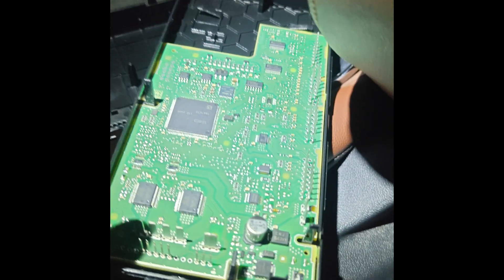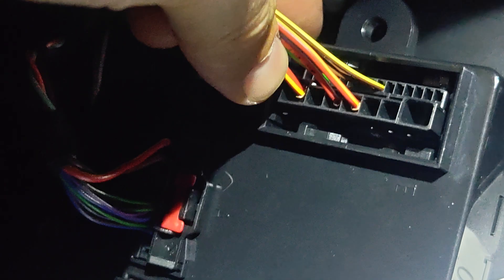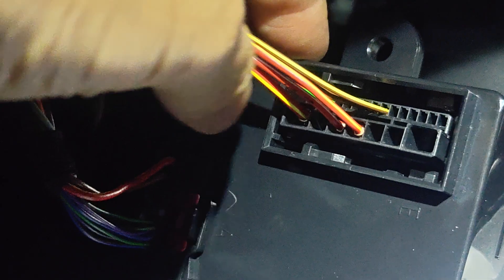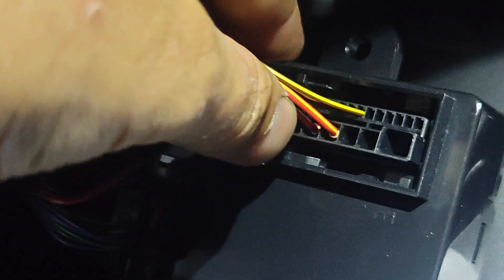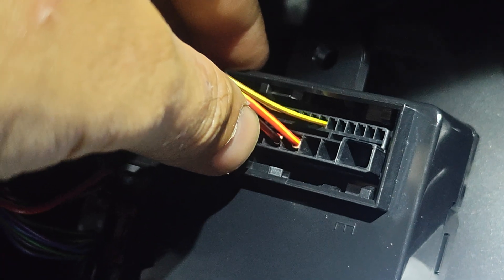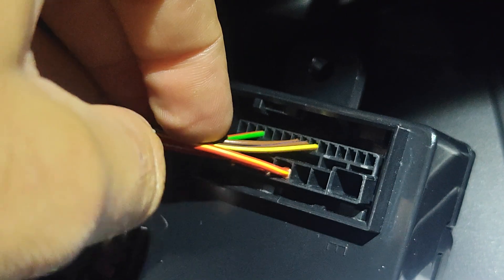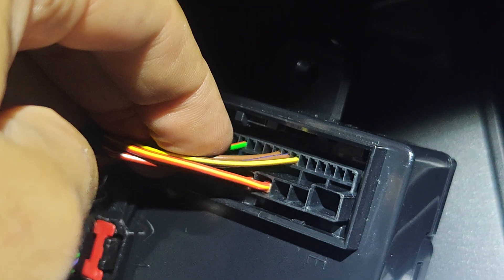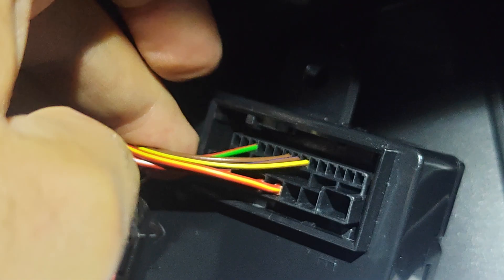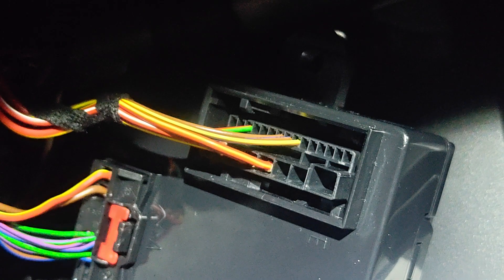I needed to inspect the gateway. Gateway wire pin number 1 has 12V — constantly positive. Pins 3 and 4 come from relay 644 in the engine bay, and that relay is fed via pin number 10. I still couldn't figure out why the gateway was not activating that relay.